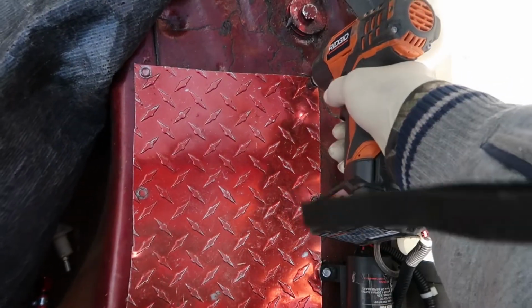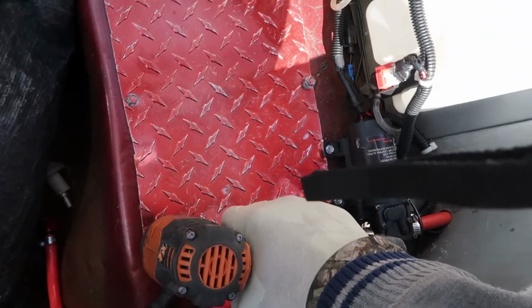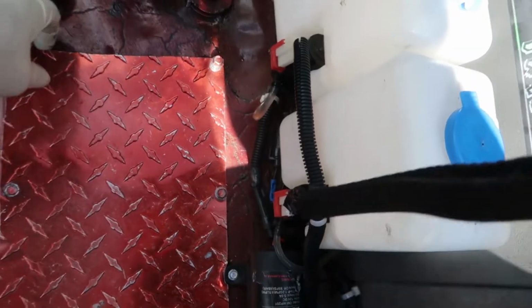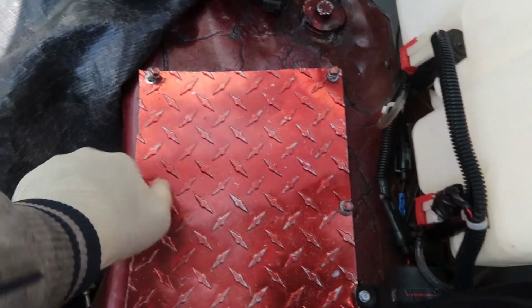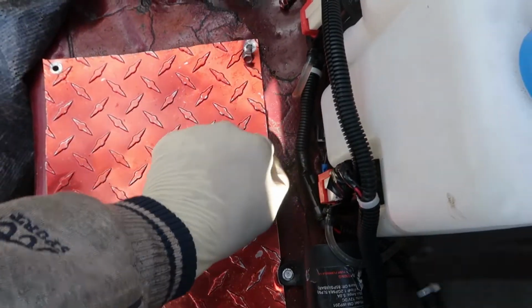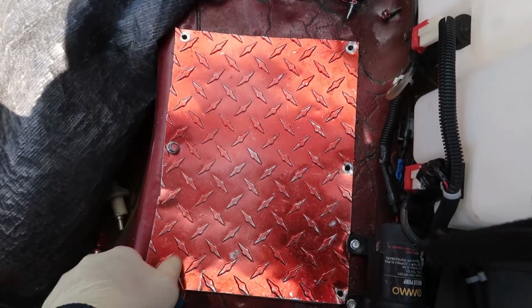All right, so I know for a lot of you guys, once you change the fuel pump, it's something that you really only do once during the lifetime of the car. But for me, I've changed it out a couple of times because of various engine modifications and stuff that I've done, and just for various troubleshooting. For instance, I had a weird issue a couple weeks ago with the car where the fuel pump just wasn't coming on, and instead of having to drop the tank out to see what was going on, I just pulled this access port off, I put wires to the fuel pump, and I was actually able to get everything going. So that's part of why I'm back here again today, to change out the fuel pump, because something's just not right here. I don't know if that's going to fix my issue, but it's only going to take me 10 minutes to figure it out, and I don't have to drop the tank.